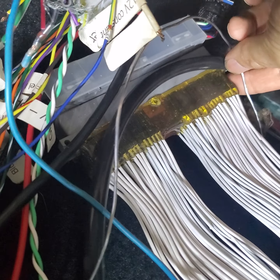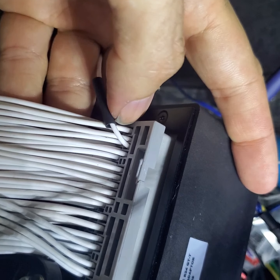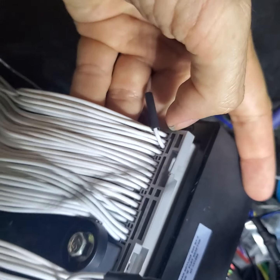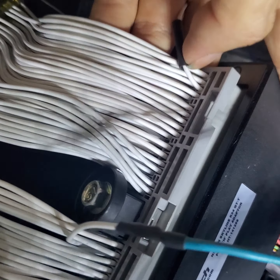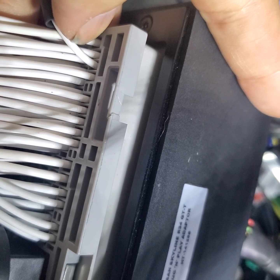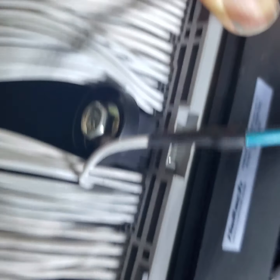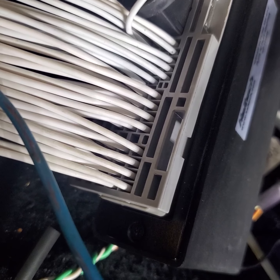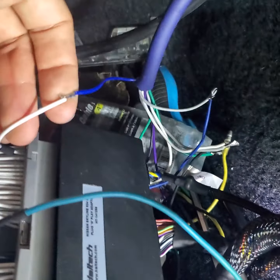So all right, according to RB25 Neo ECU pinouts, it is the third one over on the one that's offset. On the bottom, I've got it all turned upside down right now. But it's the third one over. 1, 2, 3. Notice that's an offset on that side. Normally from diagrams, I have it upside down. But if you look at this side, there's no offset at the end. So, got the wire soldered in.